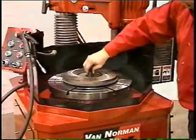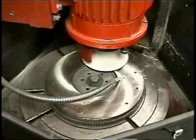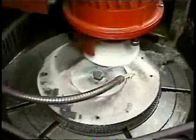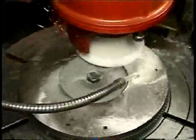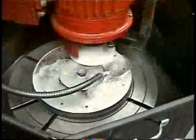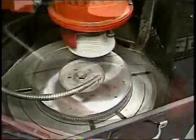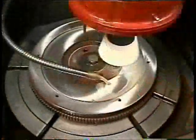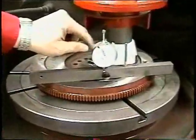Make sure when grinding the flywheel that the stone is traveling the area to be ground. Start the coolant and adjust the flow and direction. Lower the grinding wheel to make contact with the surface. When you see a foaming action occurring on the back side of the grinding surface, you are about to touch. These machines are designed for pressure feed. You must put significant down pressure on the flywheel to cut aggressively and keep the stone clean. When the surface has cleaned up, stop feeding and let the flywheel turn a few times to spark out, then ease the grinding wheel off the surface. A cupped flywheel is mounted in the same manner as the flat flywheel. Measure the depth of the cut and record it. Grind the friction surface first until it cleans up. Measure the depth of the cup again.